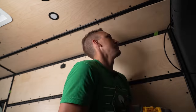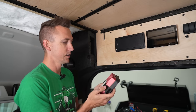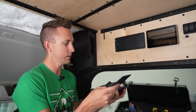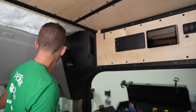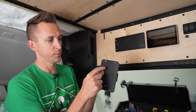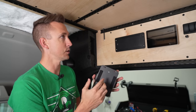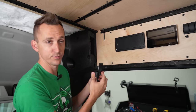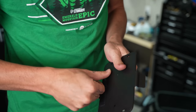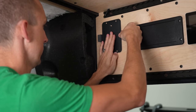Now that the ceiling is back up and the wire is through the roof, the next thing we're going to do is mount the booster to the wall. There's a little clip plate on the back of the WeBoost that just comes off. The plate has two spots for number 10 screws — I'm using number 10 by half-inch wood screws. It also has velcro backing, but since we don't have anything that'll stick to velcro, I'm going to peel that off, mount it up, clip the WeBoost into place, and connect the wire to the exterior antenna port on the booster.